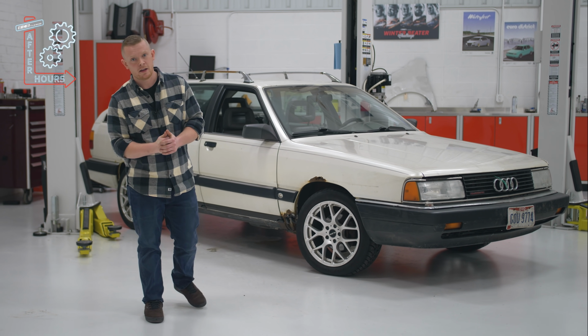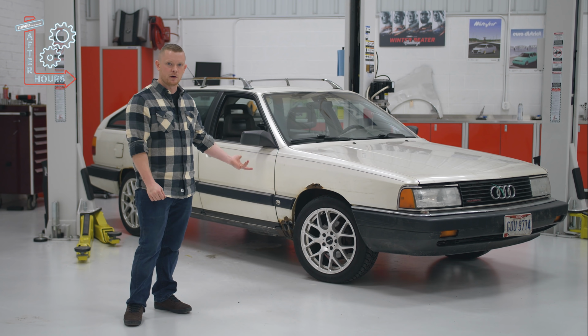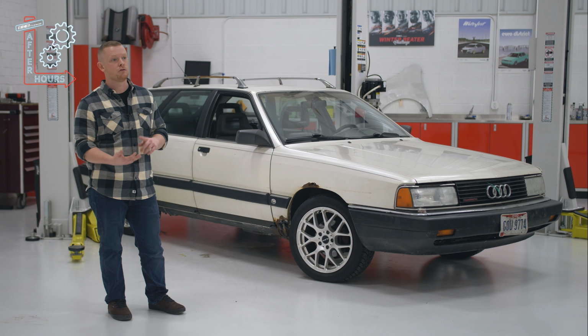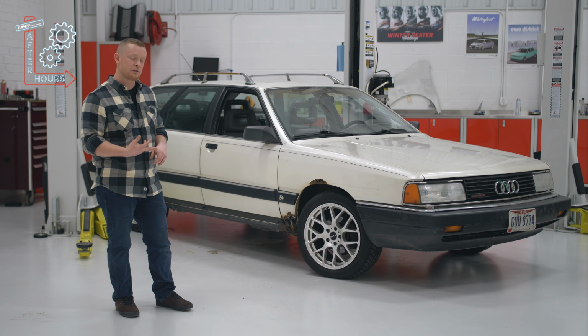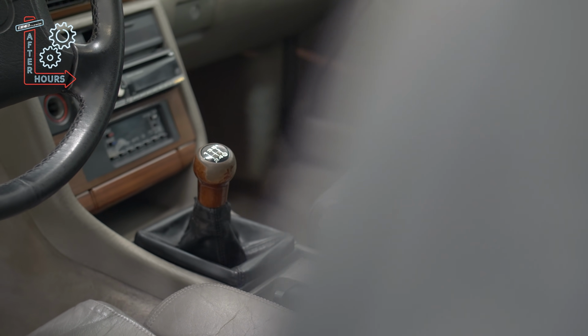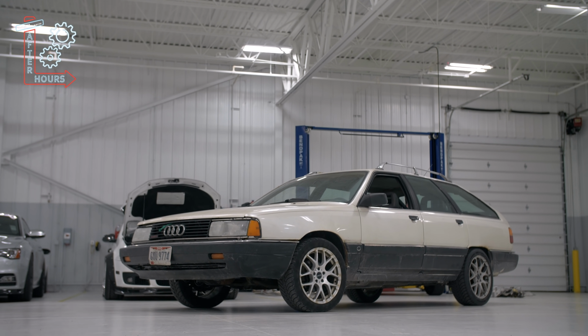Today we're back at it again. We're going to talk a little bit more in depth about my 1989 Audi 200. For those of you that are unfamiliar with older Audi chassis, the 200 came standard with a 2.2 liter inline 5 10-valve engine, K24 turbo, Audi's famous Quattro all-wheel drive system, a 5-speed manual transmission, and they slammed it all together in a package big enough to register as a land yacht.